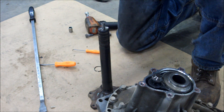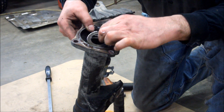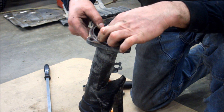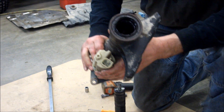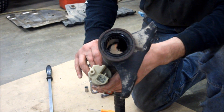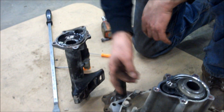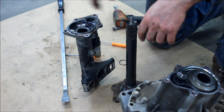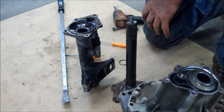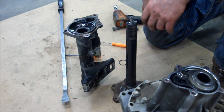Now we can get our seal. There's also a thrust bearing right here — make sure that stays put right there in that housing. Right there is the seal that we're trying to get at that's leaking. We'll need to do the same type of situation on the other side, except we're going to have to take the cases of the differential apart. We'll do this side first, reassemble it, then take the other side apart.